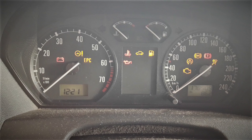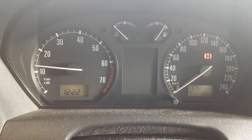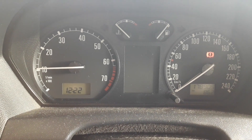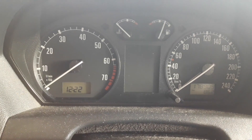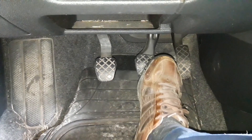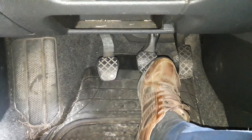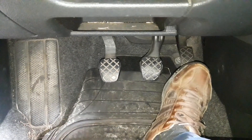Know that some cars need to have the ignition on for the brake lights to work. So if they don't work, try turning the ignition key to the on position and then check. I would also recommend starting the engine and letting it run for a minute or two before you check the brake lights. This way the pedal will be softer and you'll need less pressure, which is useful for some of the methods we're going to show you. Otherwise, when you press the pedal a couple of times with the engine off, it becomes much stiffer and harder and much more pressure is needed.